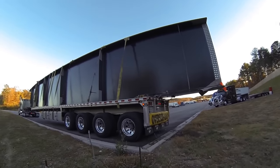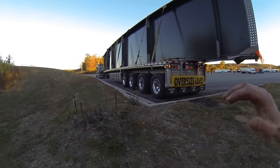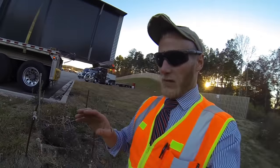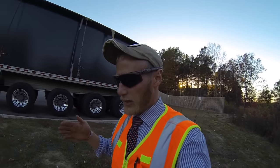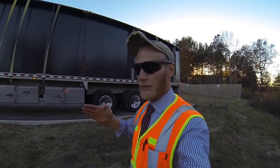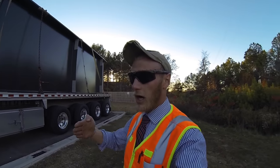It's been fun — it rides true down the road. One of the tough parts about doing these is you've got to make sure the trailer and the bunk plate are exactly in line with each other, because if not you end up with a trailer that'll dog-leg going down the road — basically the trailer would be off-tracking to whichever side you got it off at.